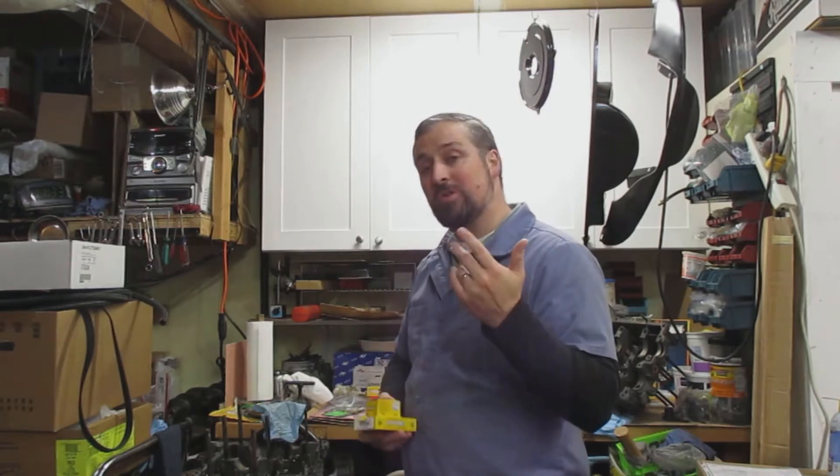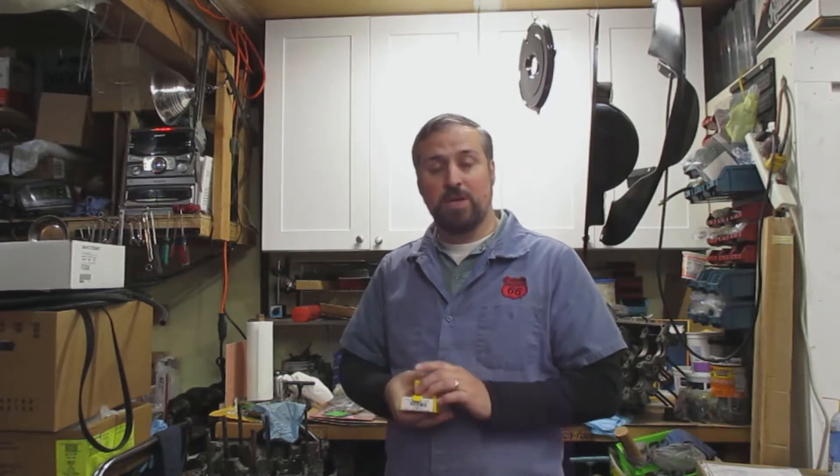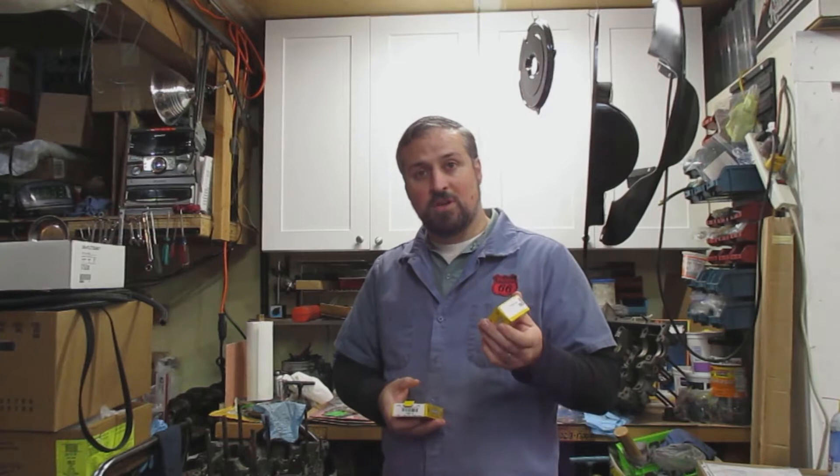Hello, welcome. I'm Michael with Mount Pack. This is day number four of the 1641 engine rebuild — it's the Series 11 2620. Last time we were installing the bearings, the crank, the gears and everything, but I didn't have my cam bearings and my connecting rod bearings — the right ones anyway. So today I'm going to install the cam bearings, the connecting rod bearings, then hopefully install the crankshaft into the case, install the cases together, and torque everything on the case to get it ready for pistons and cylinders next time.